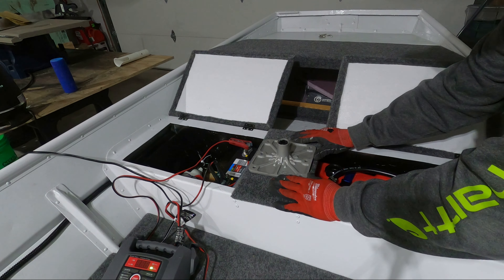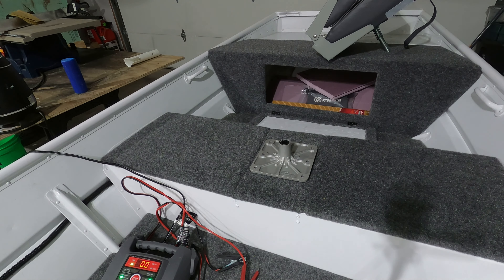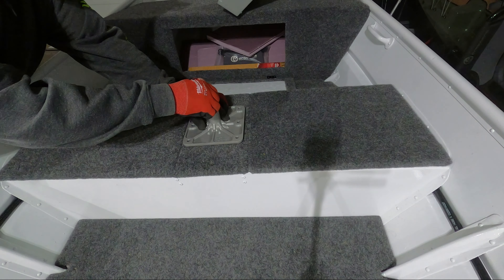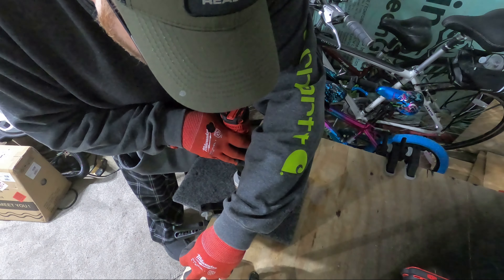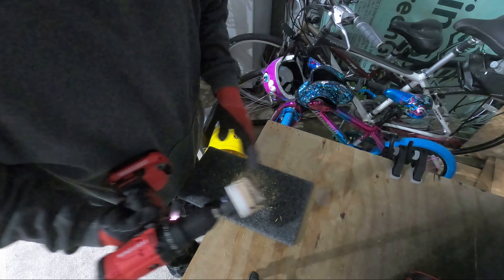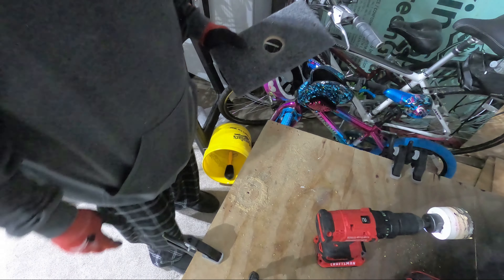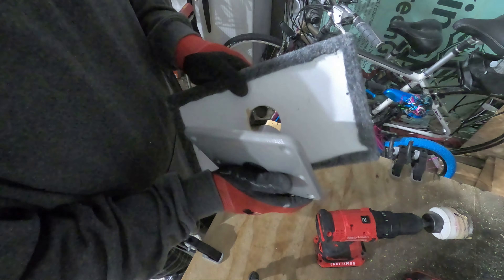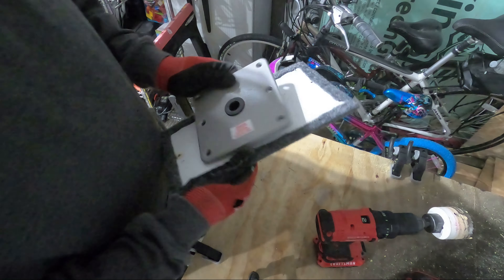For this we're just going to go right center, put the seat right there. We need to mark it out — I'm going to drop a permanent marker down so it marks the carpet and we'll have our exact drill spot. After drilling through the board, let's see if it fits. The main reason we went a little bigger was to account for the side ribs. It went a bit bigger than needed, so for the other one I'll go down a size. You can see the ribs are just barely touching — this will still work fine for the front one.